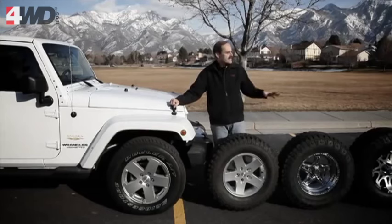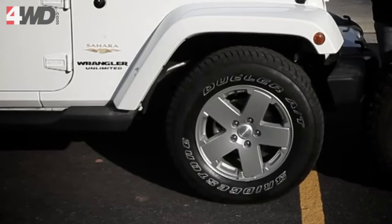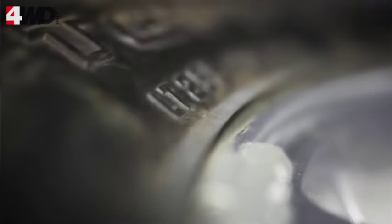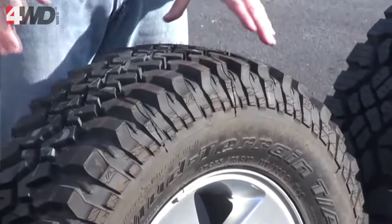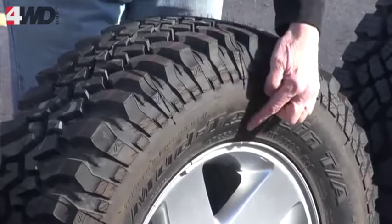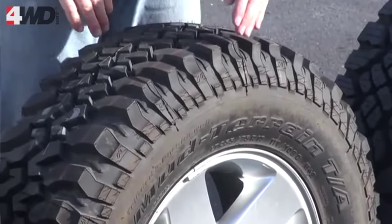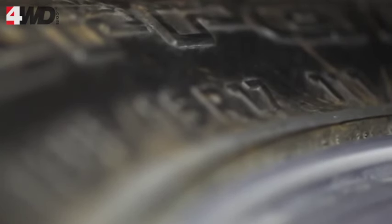The first two tires in our tire array are actually stock Jeep wheels and tires. The one on this Sahara is a 255, and this is also a 255. Let's look at the numbering system on this tire. On a metric tire, the first set of numbers — in this case the 255 — refers to the width of the tire in millimeters. The next set of numbers is a 75, which tells us how tall and narrow the tire is. A 60-series tire will have a wider tread and shorter sidewall than a 75-series, which will be narrower and taller. The next part is an R, which refers to the fact that it's a radial, and then the last two digits — 17 — tell us the wheel size.